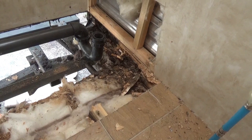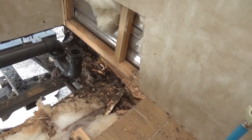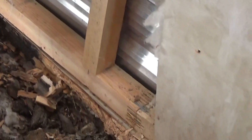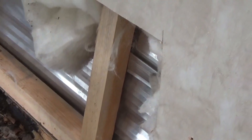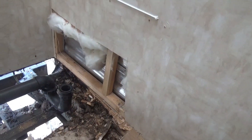The lucky thing is that the vinyl flooring actually protected the vertical structure. None of the two-by-two wall framing sitting on the floor has any water damage at all, which is a good sign. It tells us the water is not traveling down the wall from the ceiling, because there's no water at all on the base of the wall.